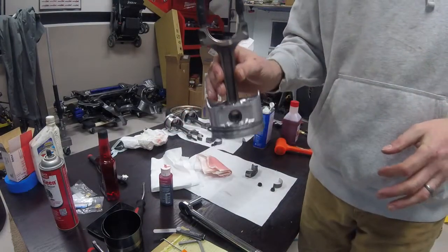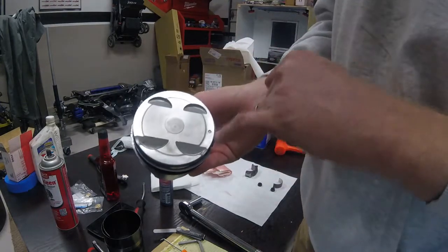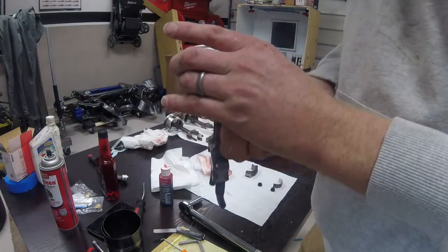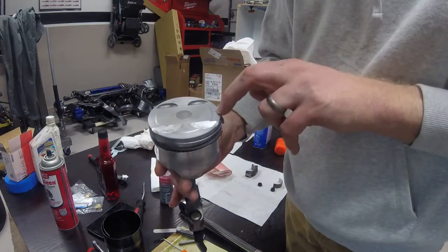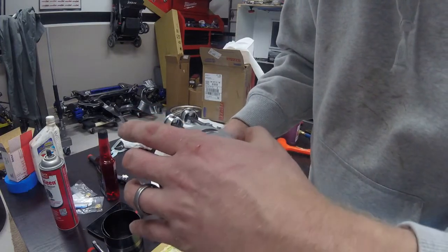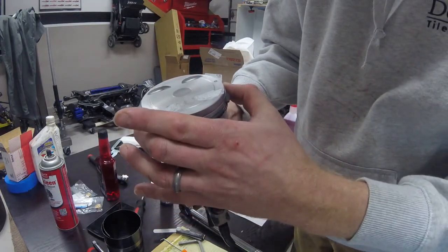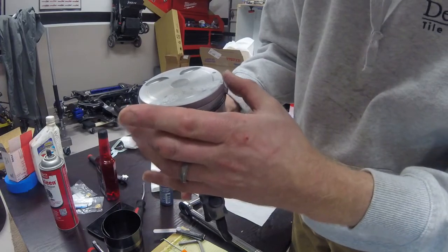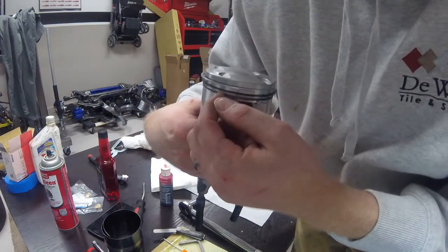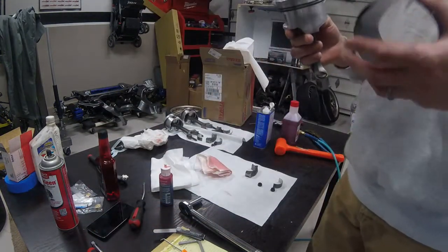This piston is just about ready for insertion into the cylinder. The dot on top indicates the front of the piston — when your ring compressor is on you can no longer see the front marking, so this dot will be your indicator. To space my ring end gaps properly: the top compression ring should be here, the oil scraper top ring is lined up there, and the bottom ring lines up around there. Now this is ready for the ring compressor.